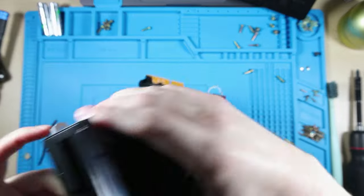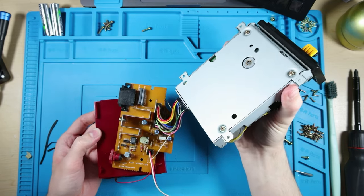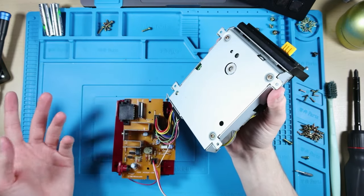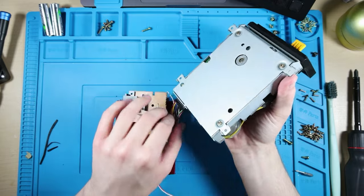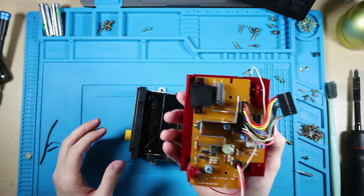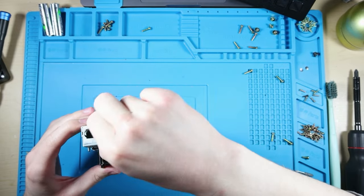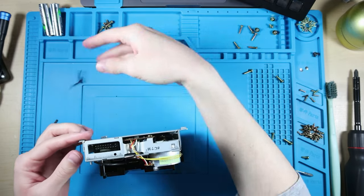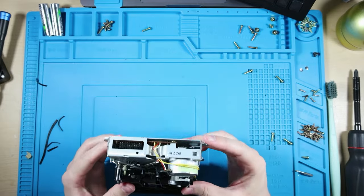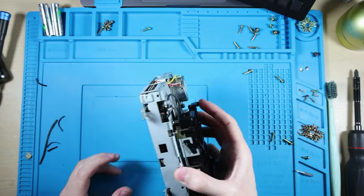Let's look at the bottom. Everything looks actually super clean and good on the power board. I might try to clean up this port a little bit — other than that, it looks beautiful. We can detach it. The Famicom does not allow you to detach the power board without desoldering it, but this disk system does. This might be double-sided tape of some sort. I think I'll just blow a bunch of dust out and then power it back on while disassembled to see what happens.